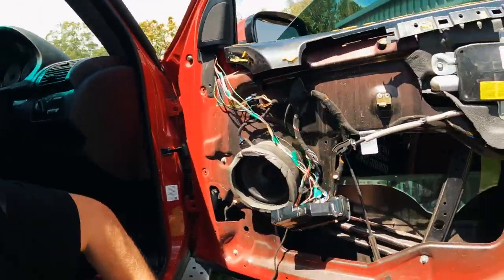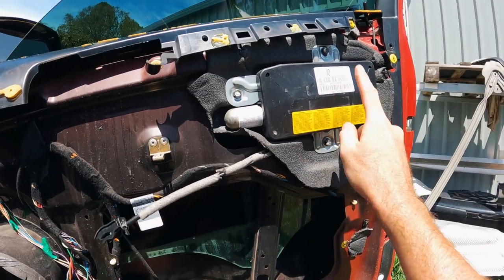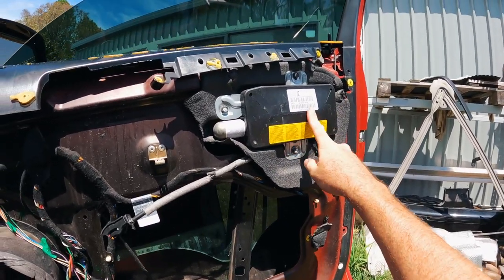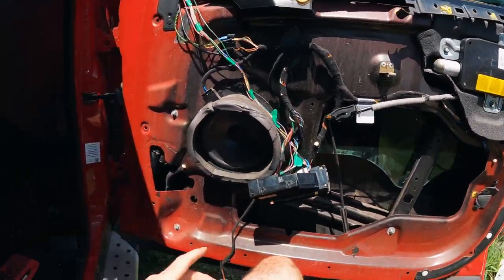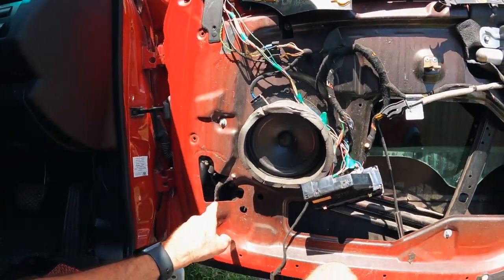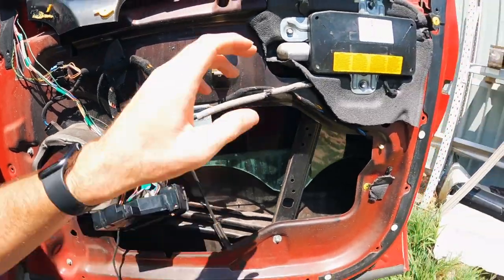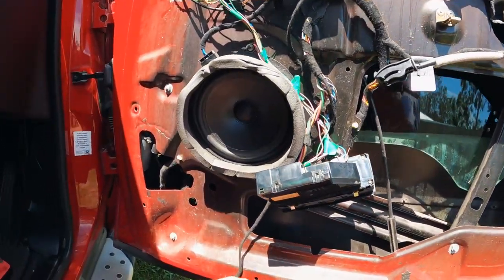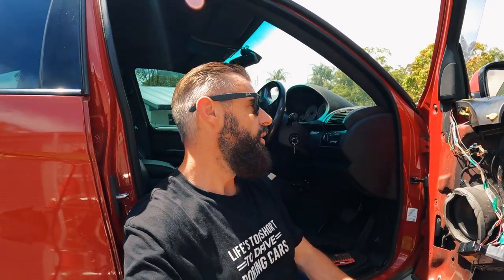Okay, I'm going to get the reg out. To remove the reg, we've got to remove the airbag. If you have one of these, it will throw an error light if the car has power when you disconnect it. So if you've got a scan tool, just clear the error after. I've got a Carly, so I'll use that. If not, make sure you unplug the battery before you disconnect these. I've never actually done a window reg on an E53, so I'm learning as I go.